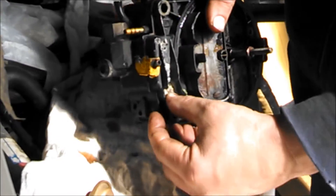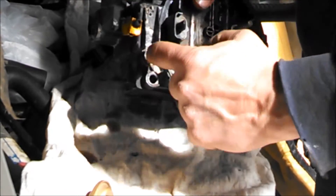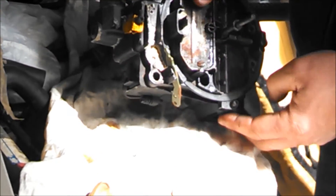The accelerator pump shaft was frozen. I actually put a screwdriver down and tapped it a little bit with a hammer and shoved it down. It doesn't want to come back up — it's probably all corroded around the top where it goes in.